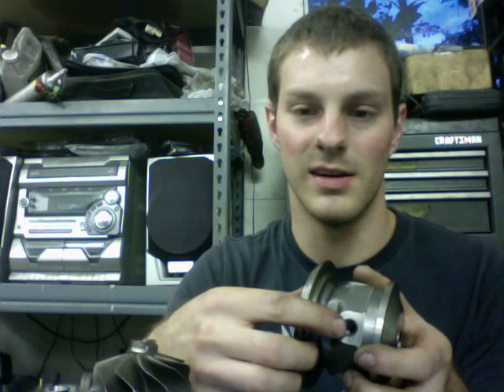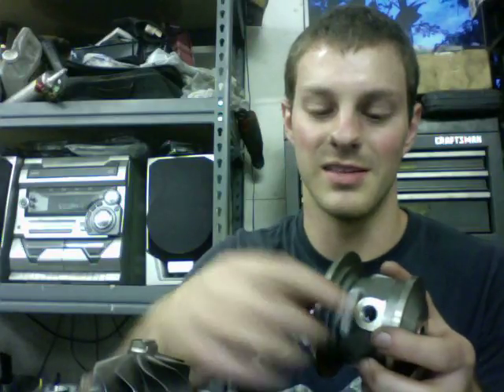Now I wanted to show you what a ball bearing turbo also looks like on the inside. So this is actually a 30R. You can see how much bigger it is on the inside where this bearing piece just slides right in. And then at the top there's a dowel pin slash restrictor thing that goes down in there that holds this cage in there. And then you'll press the shaft down in here to connect inside here. It hugs on these pieces and it has the roller bearings or the little balls inside of it — that's like a ball bearing. So it's dual ball bearing.